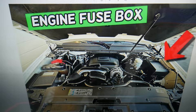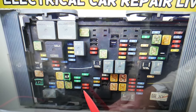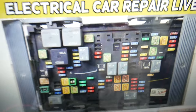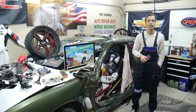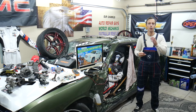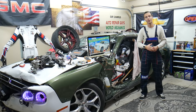Next, go under the hood. See that box here? Open that cover — that's the main engine fuse box with a layout like that one. Here, you need to check fuse number 53. If these fuses keep burning, you need to check your socket — the cigarette lighter socket. It could be a bad or burned cigarette lighter socket. We have multiple videos on our channel on how to replace the cigarette lighter socket. Hopefully the video will be helpful. Thank you for watching, see you next time.